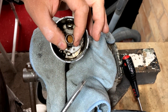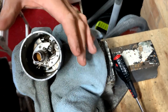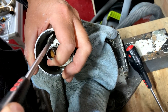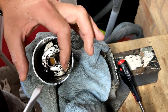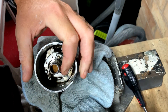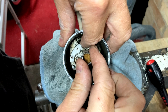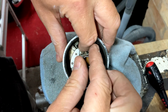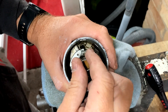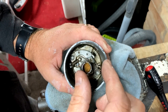It's really easy. Just drop your distributor in a vice — be careful you don't want to damage it — and then just bend the tabs to lock them in. Here's the top one — there we are, that's one locked. And the next one — locked. Now when we spin this, the arms will move slightly but not enough to allow the timing to advance. That effectively locks out the advance mechanism so it stops operating.